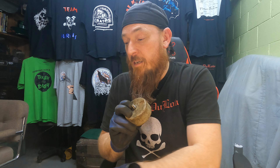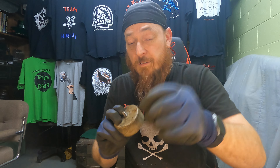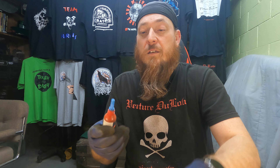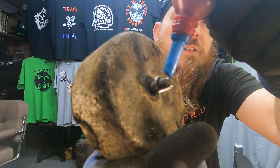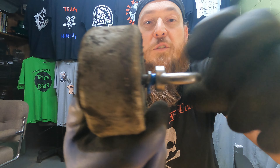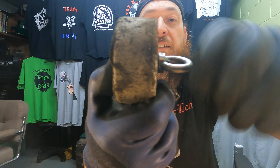Now I'm going to clean that one out. Stuck the bolt through it. Luckily we've still got the lock washer — it's stuck to the magnet. Itty bitty thing here. That will slide on top of your magnet like that. Take your Loctite — this has already been shaken up real good — and apply it to your magnet just ever so slightly. A big old glob of it definitely doesn't hurt it. Grab your eyelet, spin her back on there.